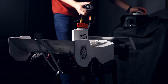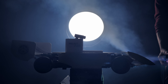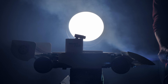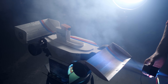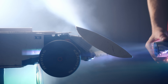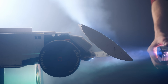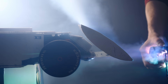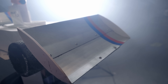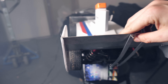What can we do to improve the version one aerodynamics? The front wing could do with being a bit smaller to improve airflow to the rear wing. As you can see there's a dead zone of low pressure over the rear wing, which is surely making the rear-end downforce less effective. I know that holding a fan up to a smoke machine is no substitute for a wind tunnel, but hopefully it gives a good idea. Also the drag of these huge surfaces could be an issue — here you can see boundary layer separation caused by the extreme angle of the wing, which creates a huge amount of drag behind the wing. For maximum downforce around one corner, this drag shouldn't make a big enough difference not to use these huge wings.